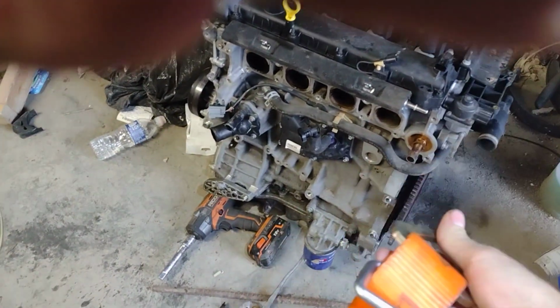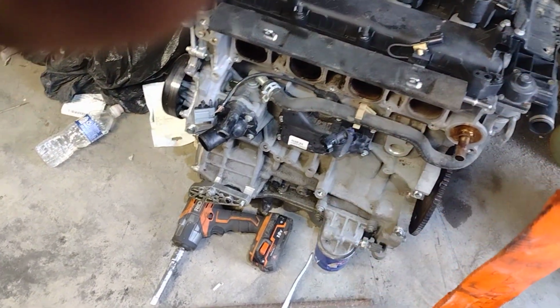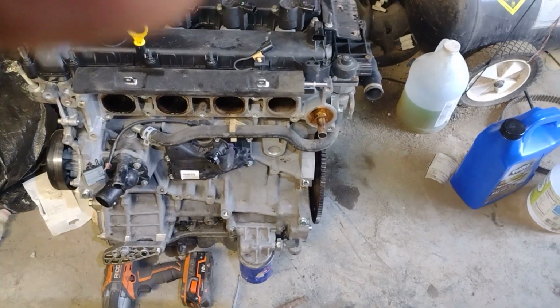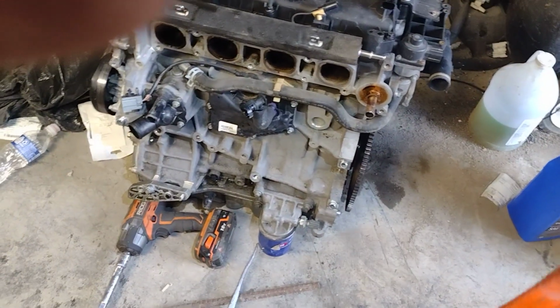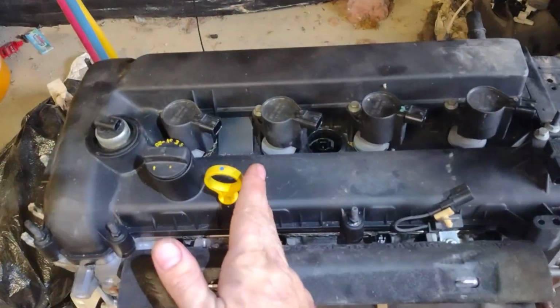because you can actually adjust the way the motor sits by this. But you got to put each one of these in these dowels down, or these standoffs down here. They're the same thread as the transmission bolts on this car. I actually have a Ford Escort that I borrowed the bolts from, but you put them on these bosses down here and here in the back. There's bosses down there at the very bottom, but you put it right almost in the center, and you put them a little bit staggered, like one here and then one there, but they're right in the center.